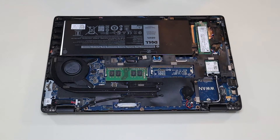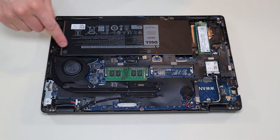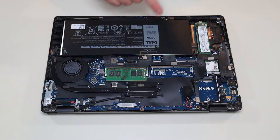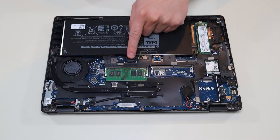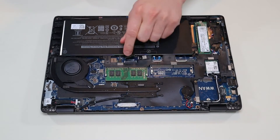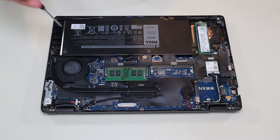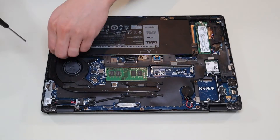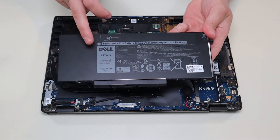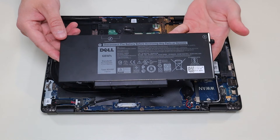The first thing I do when opening any computer is either remove or unplug your battery — that limits any power running through the computer and makes it safer to work on. To remove the battery, there's a screw here and a screw there, and your battery plug is right there. If your computer hasn't been opened before, there'll be a black pull tab on top of your battery port — you just pull that straight up and it unplugs from the motherboard. I'll have the battery specs for this computer below in the description if you're looking for a replacement.